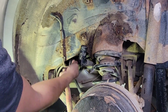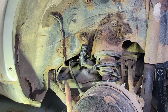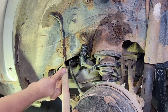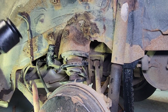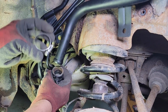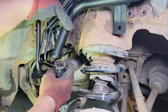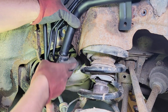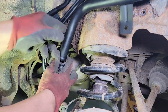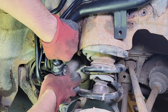The main hose, the vent hose, and the evap hose are nice and clean. This is the only one right here that we're going to cut to length. Before we cut it, we're going to line this new filler neck up here. We'll put a 1/2 inch clamp here first before we put the hose into the steel line. Just going to line her up and get everything all set before we tighten everything down.